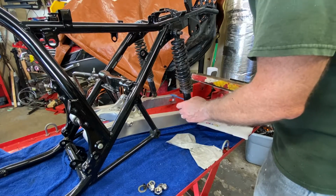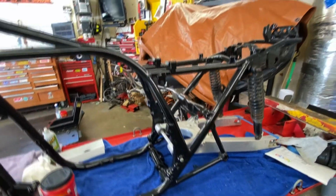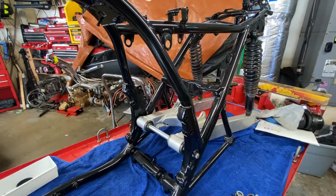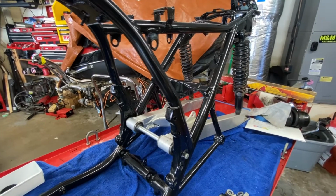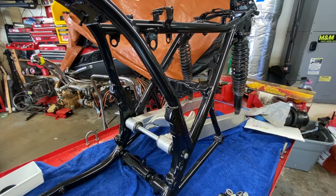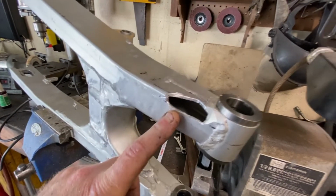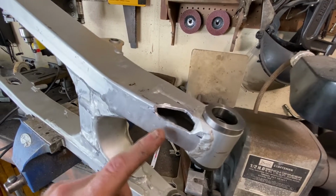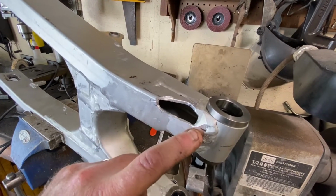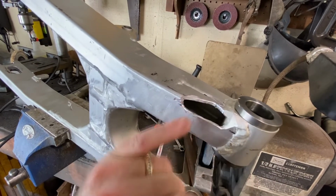You see, it will go down a little further, but then it hits that spot over here that I've been grinding or cutting the aluminum out to accommodate. We can do those measurements another time. So the proof of concept, in my opinion, is that it would work with some modifications to that spot that I just cut out, which I'm going to show you my thought process on here in a second. My thought process is essentially what we're looking at is the nominal opening size, the clearance size, okay? So let's say I open this up another 1/8 inch. I can't go too far this way more, but I probably can go up to the inside, so that'll give me about 1/8.